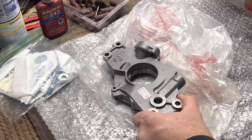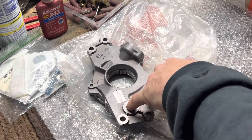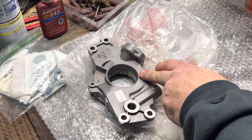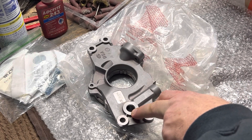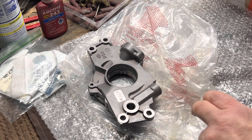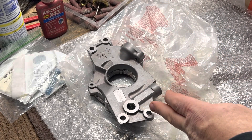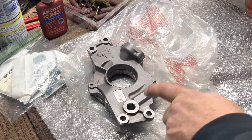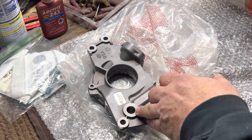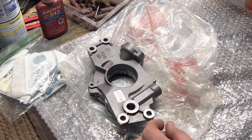As you can tell on this pump, I haven't made this hole much if any bigger, but from the pump cavity to where it enters your block - I'm going to refer to it as a dog's leg - it comes out of the cavity and it turns at least two times to get to this point.